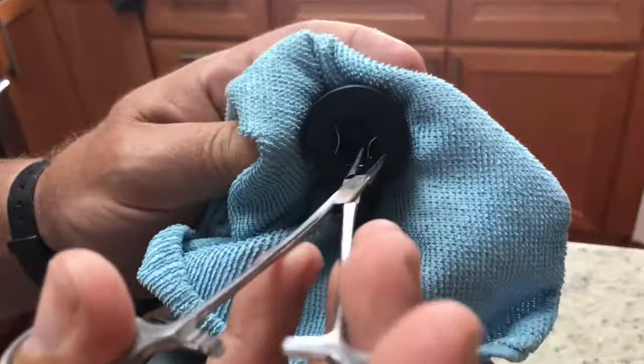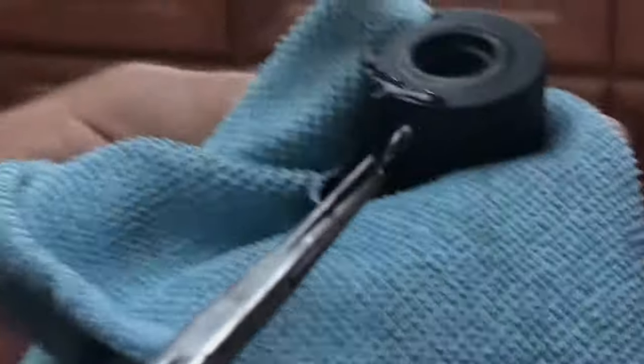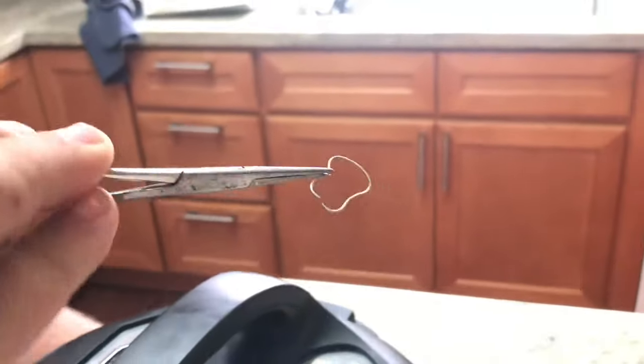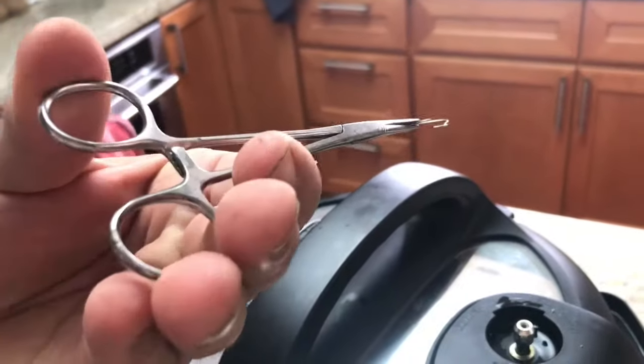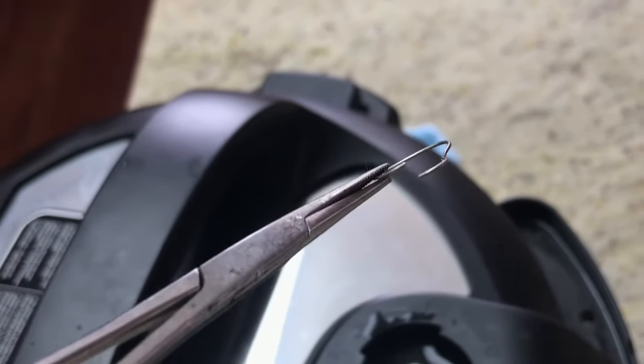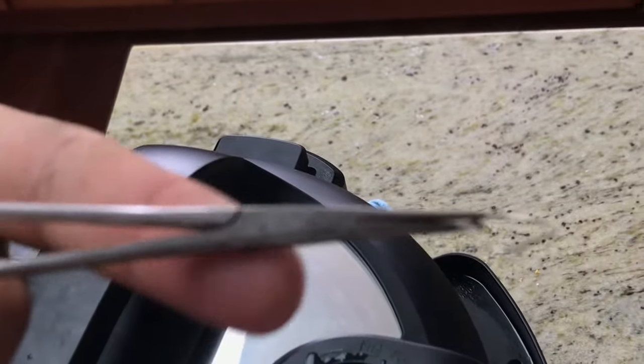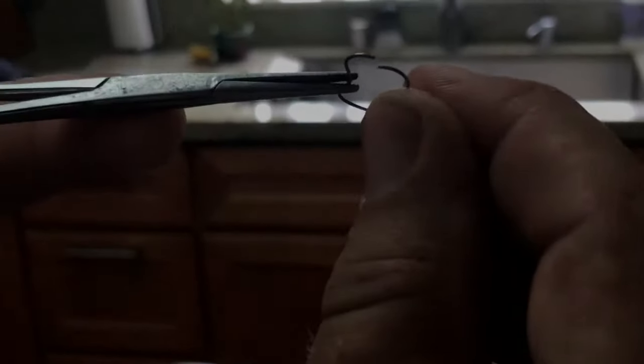The problem is this clip — it's made out of steel. Inside the steam release valve it gets bent, and if you can see after you pull the valve off, after six or eight months it becomes distorted. It's probably the best Chinese steel you can get, but still it doesn't work. So the fix is to take this wire and bend it so that it's straight again.